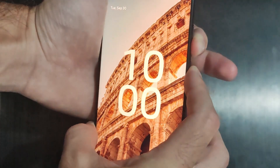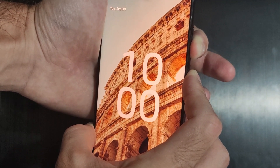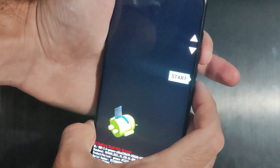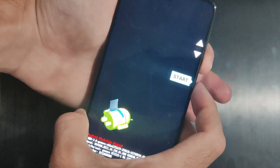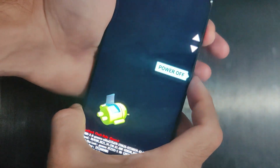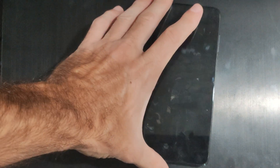So let's hold these down. I'm going to go to the black screen now once it force restarts. On Motorola, just hold down the volume down and power. On your other version, hold down the volume up and the power button. Then we can cycle through this menu and go to power off and tap power. And your Android phone should be remaining off now.